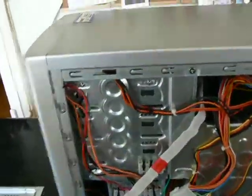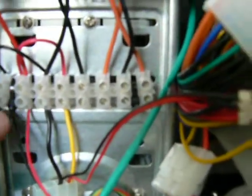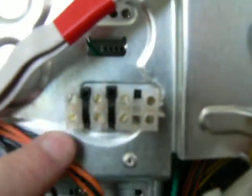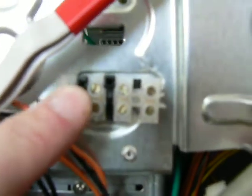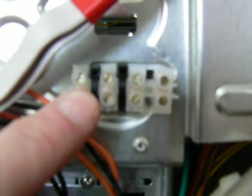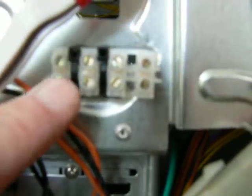Let's have a look down here. As you can see, we've got an 8-way terminal block in here, which fits very nicely on the back of the hard drive bay. That was originally a 12-way but I've cut four off and put that one up there. What I might use this for is stripping off a molex and running that in here, so I've got a 12 volt and a 5 volt rail, plus two earths. That gives me options to run something at 12V, or even at 7 volts.